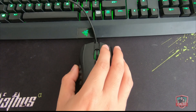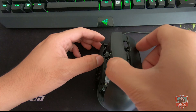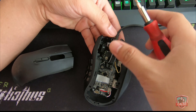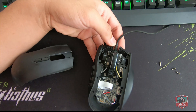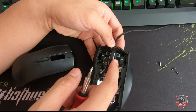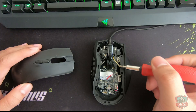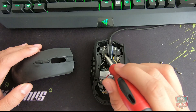These are some of the advantages we get from a fully programmable mouse. Additionally, when we open the mouse, we can test the buttons located at the front side. Pressing the right key scrolls up, and pressing the left key scrolls down. The problem is that the scroll wheel's communication does not reach these keys. So a second workaround is: instead of scrolling the wheel, push it to the sides — right for page up and left for page down. If this does not fix it, you can try changing the encoder for the mouse wheel — this white strap you see on the right side. I've seen these straps sold on e-commerce sites such as eBay and Lazada at a low price, so it's worth the shot.